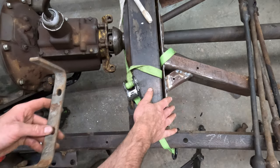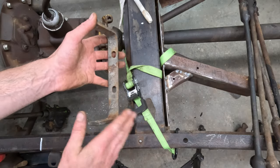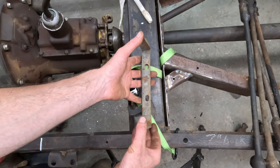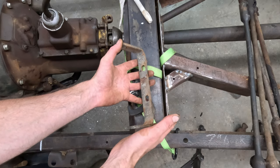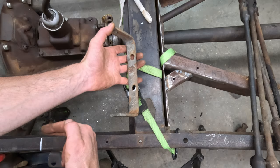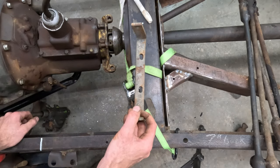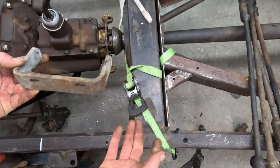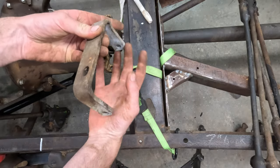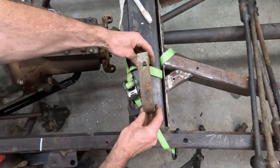Mounting it on the back side, you essentially have to double the height of this or shorten your arm length, because one arm is going to be up and one arm is going to be down. If this is pointing down — in a Z or N shape — when you pull on this it would push on that, which will actuate your master cylinder at the rear. So if your master cylinder is in the front you need a pull and push forward; if it's in the rear you need a pull and push backwards. There's really a ton of options — something like this from the scrap pile could just use as a pivot point, weld brackets down there, put some bolts through, and it could pivot back and forth. Drill a hole here for the brake rod and here for the master cylinder rod.